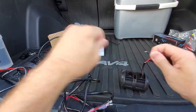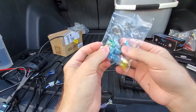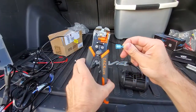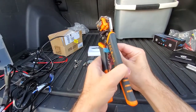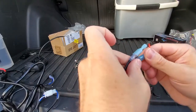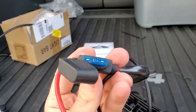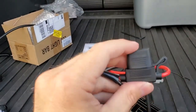The first thing we do is connect the side shooters to the wire harness by using the spade connectors included in the kit. We simply crimped the wires to the spade connectors, but off-camera I actually soldered these for a stronger hold. We temporarily connect our lights to the wire kit to confirm that things work. I also changed the fuse to match just around the wattage my lights will pull. You can find the math all over the internet because I'm not savvy with electricity.